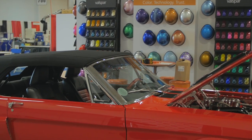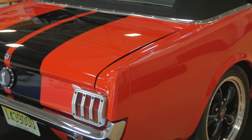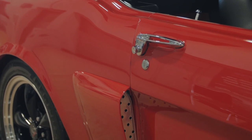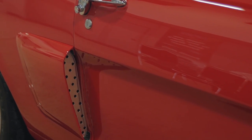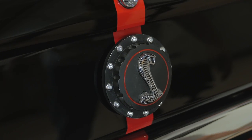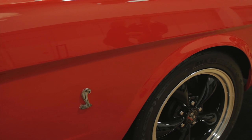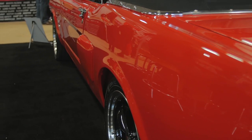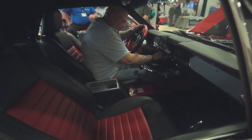This clear here that we use is the clear. Personally, I think it's a pretty damn good clear. I put on all four coats as wet as one after the other, same thickness, consistency all the way through. I shoot it around 25 pounds and it lays out nice. The finish speaks for itself.